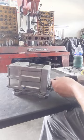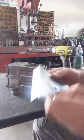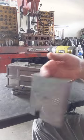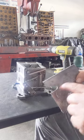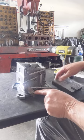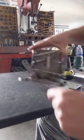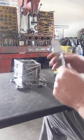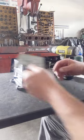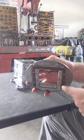All right, now let's go ahead and take this bolt off here to remove that back cover. Alright, this is just like a dust cover. Basically, there's no gasket or anything. If yours, like the older 5000 series, isn't slotted right here, it might just be round. Then you're going to need to take this lever off right here, take that all off so you can slide that out. And then once you do that, you can always modify that. Just cut it yourself. That's how a lot of the 5000 series just have a hole there only. Alright, going back to the air horn, I didn't mention it does have a gasket, okay? So that's one of the gaskets you'll be replacing.